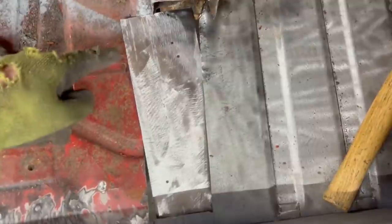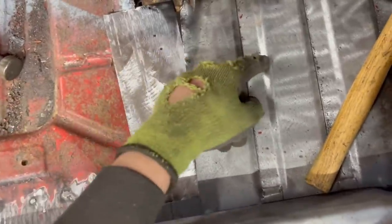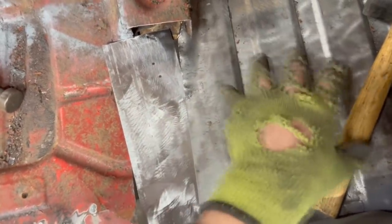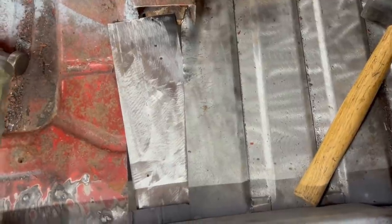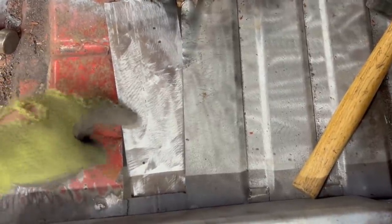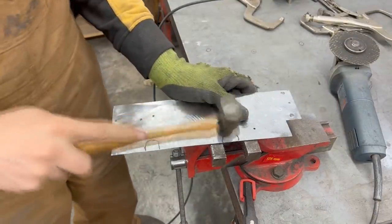So I cut a piece of metal over here, but before I cut it to shape to match the exact opening, we're gonna make those channels here. We're just gonna make them end here. They used to go all the way to the front, and these are literally water channels. So if water collects here, it's supposed to drain this way, and somewhere there's a plug hole, but of course we're not gonna allow water to come inside the car, right? And if it comes, we're gonna dry it, but we're not gonna let it drain on its own. So we're just gonna make it end here and here. So I'm gonna mark them and I'll show you how we're gonna make them. This is how we're gonna make them.